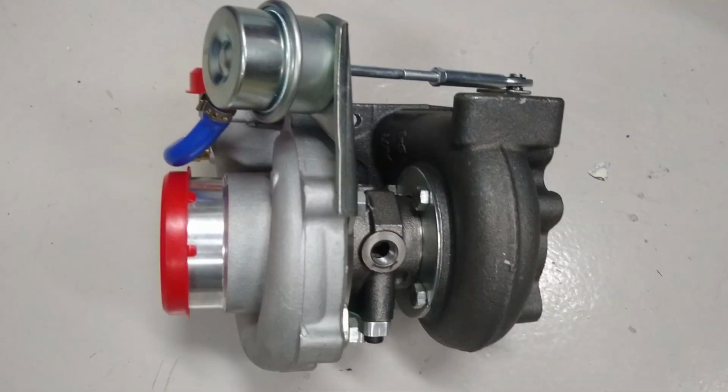So I have a T28 turbo, as we Americans affectionately call basically eBay-bought Chinese knockoff turbos. It is a knockoff of a Garrett T28 turbocharger. The one issue people have with the turbos, well, there's a lot of issues, but the main issue is there's not a set type of fitting for each turbo. They vary in thread and pitch and so forth, so it can be a little difficult tracking down the fittings that you're going to need to use on your turbo.